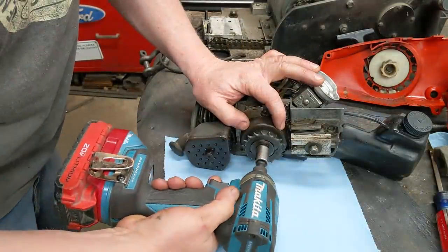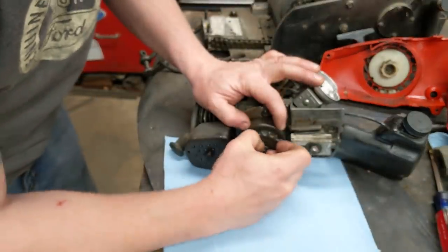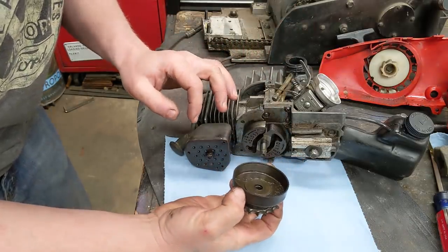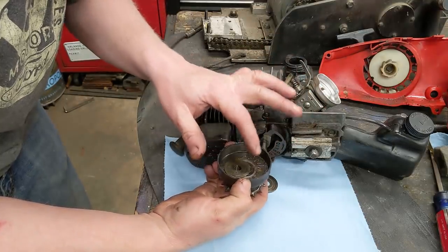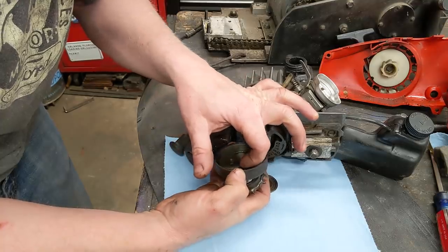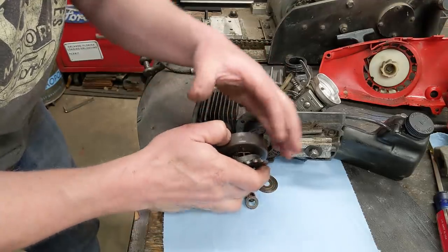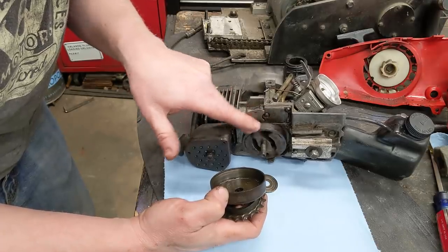Let's get in here and inspect the clutch. The sprocket — take the whole thing off. The thickness on this looks fine, but we've got over-grease. Somebody's greased the little roller needle bearings in there too much and grease is all over. Well, I guess it could be from the chain as well, just greasing the chain and flinging everywhere. This clutch is definitely going to slip with this much oil on it.